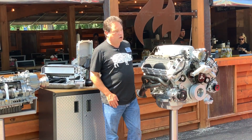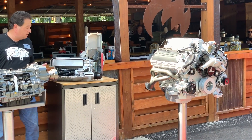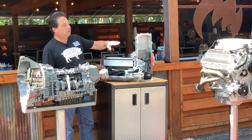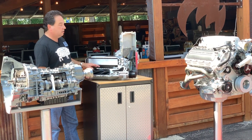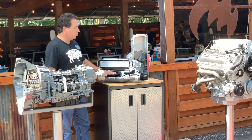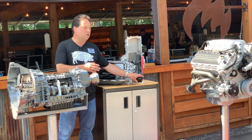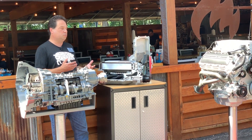Moving up top to the supercharger — the airflow comes in underneath, so it's a reverse flow. That allows us to tuck the supercharger down in the valley so we can get it under the elegant low hood line. The airflow comes in underneath through this Eaton supercharger. It's 2,650 cc, or 2.65 liters. The airflow comes up through the intercooler and then out through to the cylinder heads. It has a one-way clutch to handle the torsional loads from a big supercharger like this, so it stays quiet, smooth, and durable.